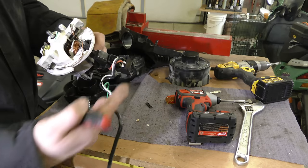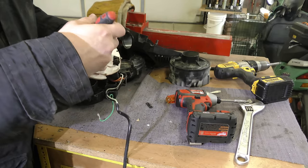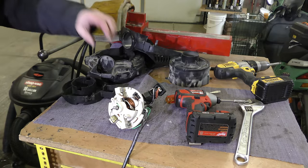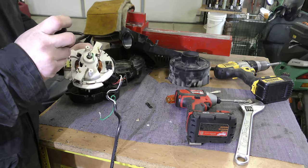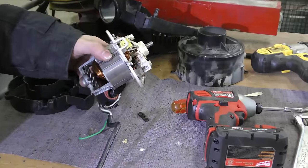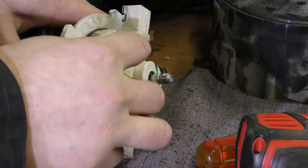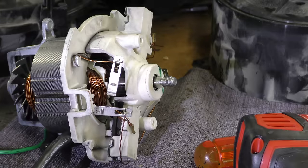So let's see if we can get this out here. There is not much to see in the switch so I'm not going to bother taking the switch out. Let's see if we can pry this out here. The vacuum next to me I think was six months old when it failed — the switch gave out, contacts burned up and that was it. So we pried this little yellow box out. I'm going to pop that yellow looking box out. There's the two wires going into it, the contacts. Here's all that's left of this yellow box.